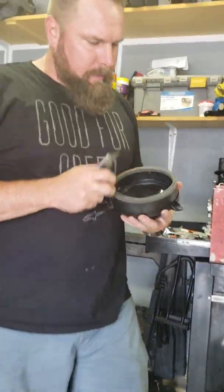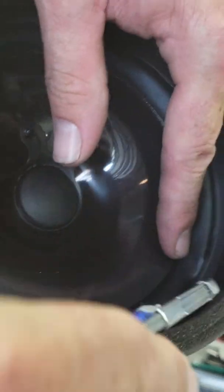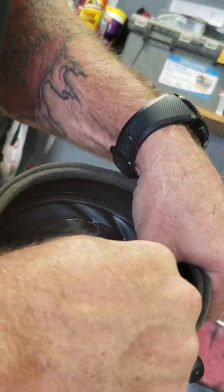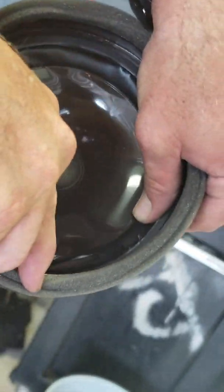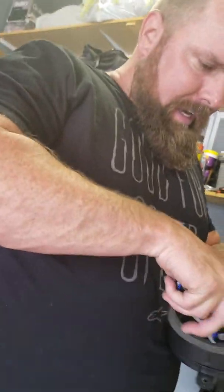The first thing we're going to do - you can see this rubber lip for the speaker. What we're going to do is cut this rubber lip all the way around. If you have a good knife, this is the fourth speaker I've done. I didn't do anything about pulling the door panel off or getting the speaker out - you don't have to cover that here, you can kind of look at what I'm doing and I'll show more at the end.